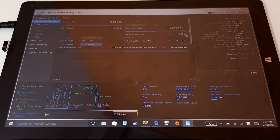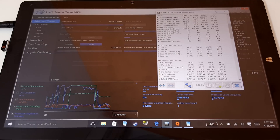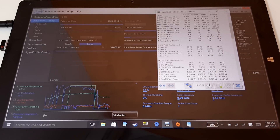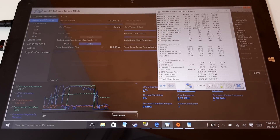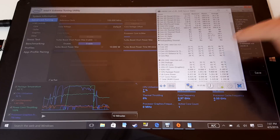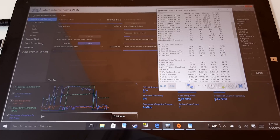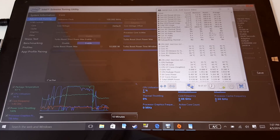When I do the review, I'll be reviewing it as stock, not with the mods. Back to temperatures: the max temperature is now 65 degrees with the stock power limit in place — down from 88 degrees max before the mod. That improvement from just a piece of copper that cost maybe two or three dollars is brilliant.